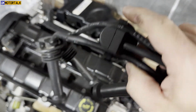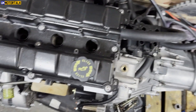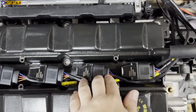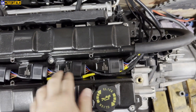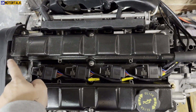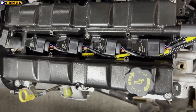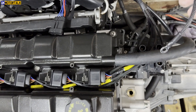So the first thing I've decided to do — I've popped down to the garage and I've just taken off the original spark plug leads. I'll just check the engine turns over — still okay, and all good. Then we've got the coils and plugs to fit and the little lead that goes with that. They fit all quite nice and neatly underneath here — slightly proud. I seem to remember thinking that the ST170 had taller plugs for some reason. But nevertheless, that all fits nice and tightly in there. I've tucked all the yellow labels to the side. There is still a cable to go across to the solenoid, but that's part of the other loom so I'll do that later when I put the other part of the loom in.